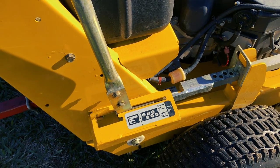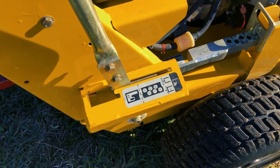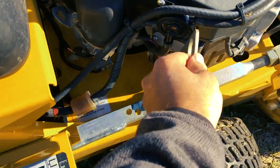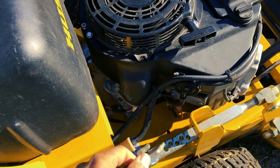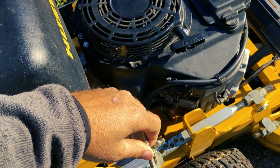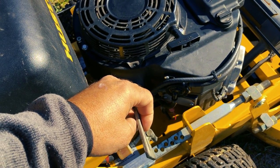I'm going to save you guys some embarrassing dumb moments on YouTube. If you buy these Trimstars, there is a pin right here - it decks down right now. There's a flat side and then there is the rod welded to the back side. You punch it this way and there is a quarter of an inch difference - you get a quarter of an inch lower if you put the plate up.